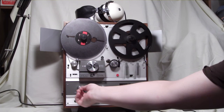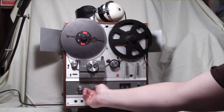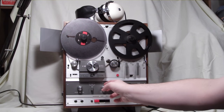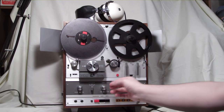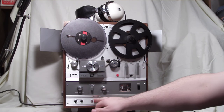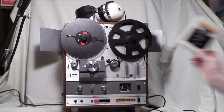Here you have left and right volume controls. And then the tape equalization switch, to set your sound level equalization based on the speed of your recording. These outer knobs are the tone controls — more bass to the left, and more treble to the right. Down here, left and right microphone inputs in case you want to record from a microphone. And here you have the mode selector — cart and reel — and then transfer, the orange button, which is for transferring from your reel to 8-track tape.